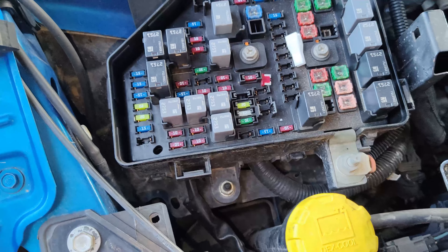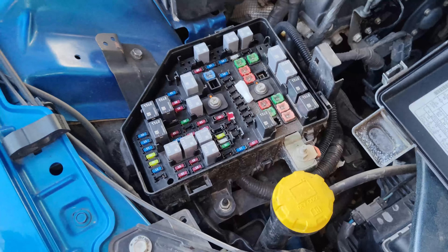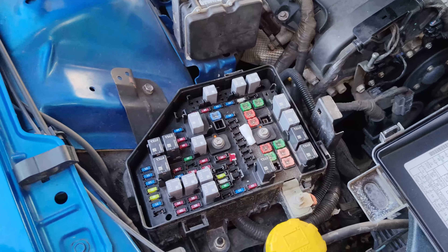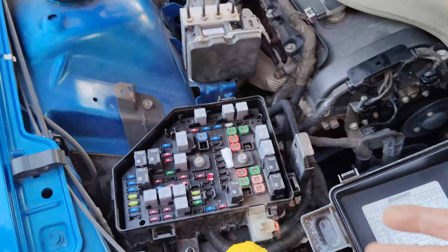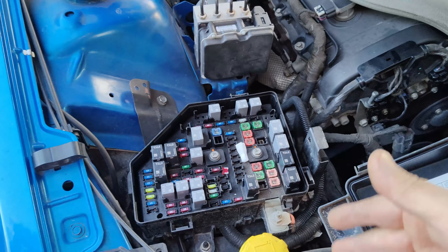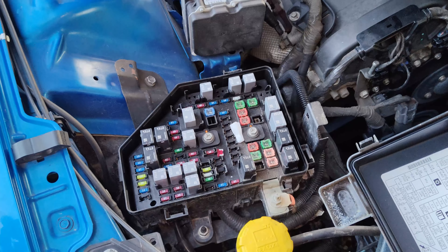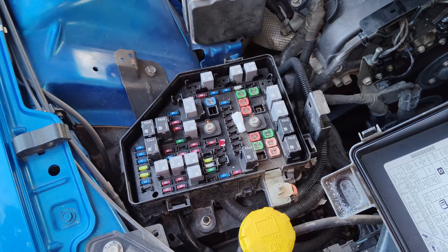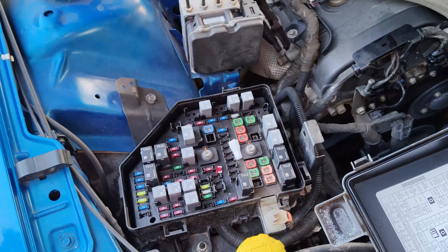This damn car has two different fuses for the left-hand and right-hand side taillights. Lesson learnt — do go over and check all the fuses first. But had I not found this, or had this not been the problem, the other approach I would have still gone about. I just don't know why they didn't do that from the factory — have all the taillights on one line, like most cars do.